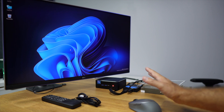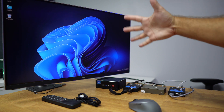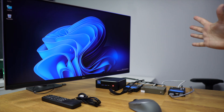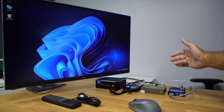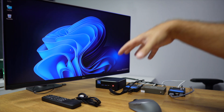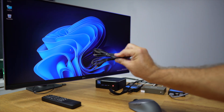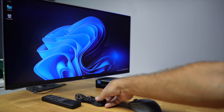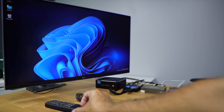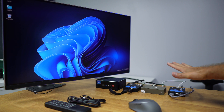The transmitter is connected via ethernet to the switch, and another cable goes from the switch to the receiver. At the receiver we have a keyboard and mouse combo, and we can control the computer with no delay at all — so we can play games or anything else without any issues. The HDMI cable connected to the receiver is the one we connect to our display. I did not connect the infrared cables because I'm not using a remote, but if we want to use a remote for Netflix, Plex, Jellyfin, or any other app, we can take advantage of the infrared and connect those two cables.